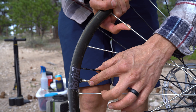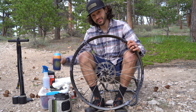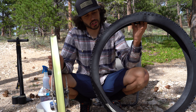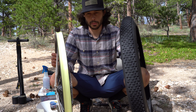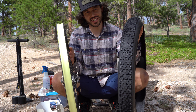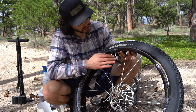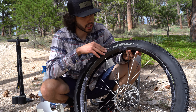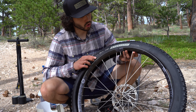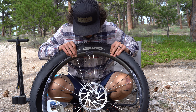When you're shopping for tubeless valves, you basically want them to be long enough so that you can actually put a floor pump or a hand pump on it — and that's plenty of room right there. One thing to note: most tires are actually directional, so make sure it's in the proper orientation. I like to think of the rotor always being on the left-hand side of my bike — that helps aid in mounting the tire. I've definitely mounted the tire in the wrong direction plenty of times. As for the valve orientation, I like to put the brand name or the name of the tire right below my valve.